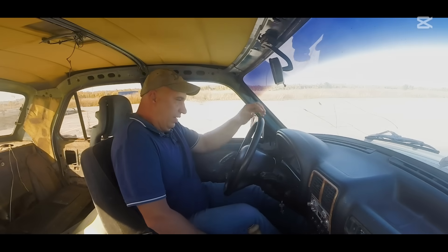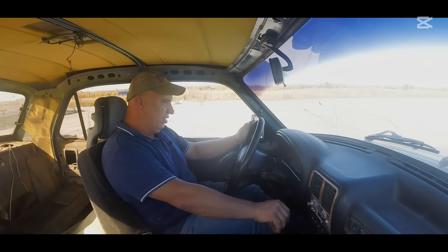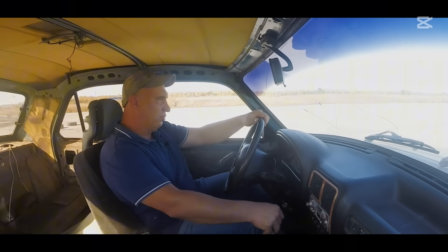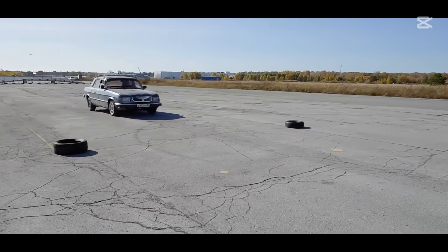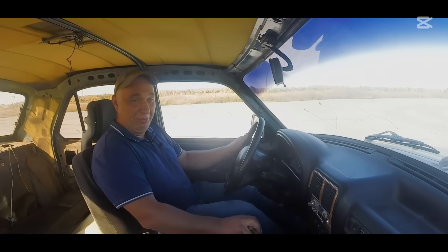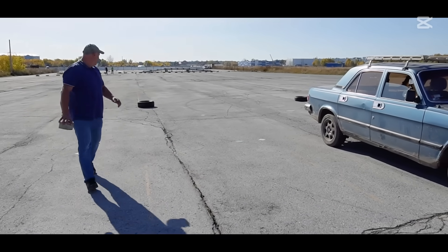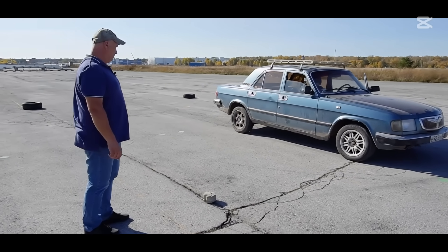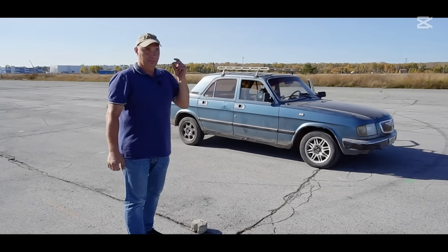Okay, we are ready. As for how fast we'll be going — we didn't bring our race logic with us, but I'll shift into second and maintain an engine speed of about 3,000 RPM. That was terrifying. It does not stop at all with just the front brakes working. We stopped at right about that mark. I'm going to place this so that we know the stopping distance with dry brake rotors. Terrific — is that where it should be? Yes, it is. Back to the line, apply something, and go for another round.